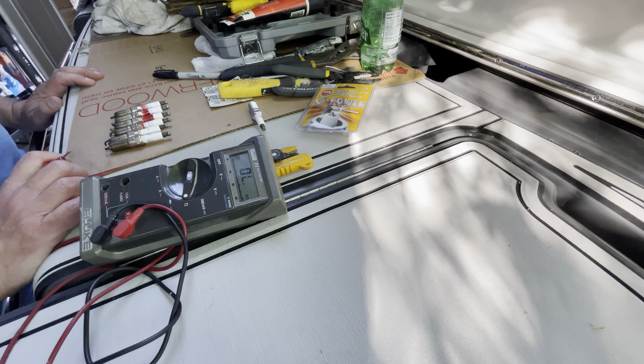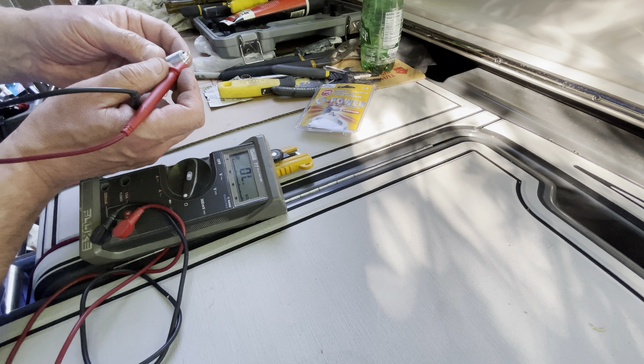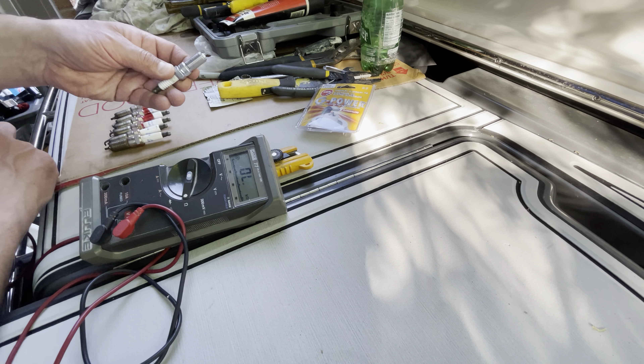What we did earlier today: we checked spark plug wires for consistent readings and they were all fine. Also, just recently we completed a test of ignition coils — six of them — by using one good spark plug connected to every single wire. How you test it is you're looking for a spark coming out, and we did record every single reading — that's gonna be in the next video. We got a spark from every single wire using one spark plug.